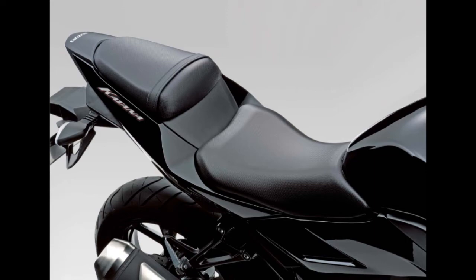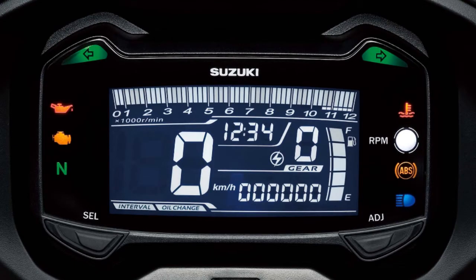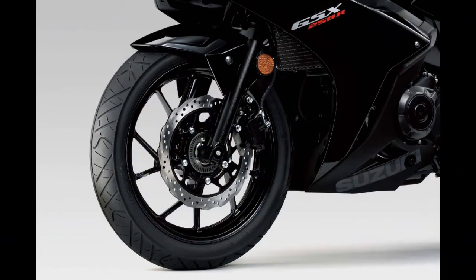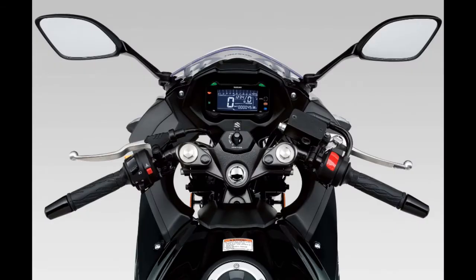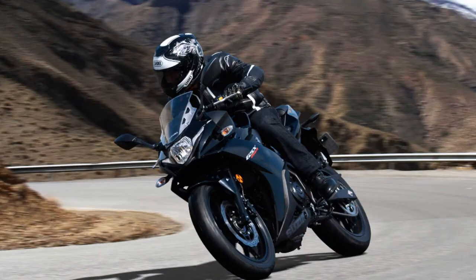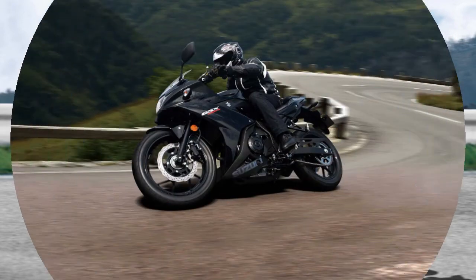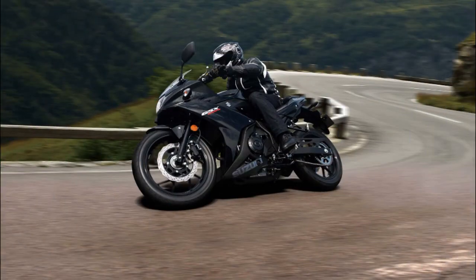The powerplant is based on the one used on the Suzuki GW250, only refined for low to mid-range torque. The camshaft profiles were designed to optimize performance at speeds between 15 to 55 miles per hour. New intake valves have a slimmer stem profile near the heads to improve airflow into the combustion chamber, while new rocker arms reduce mechanical losses from manipulating the valves. Further frictional losses were reduced by using a new oil pump design and reshaped low-tension piston rings.